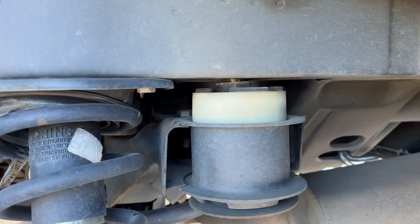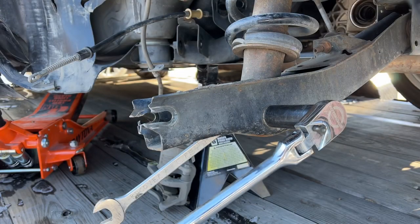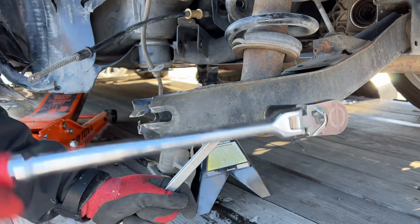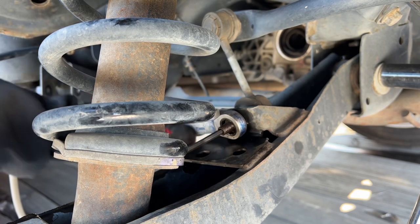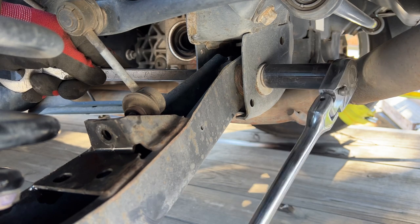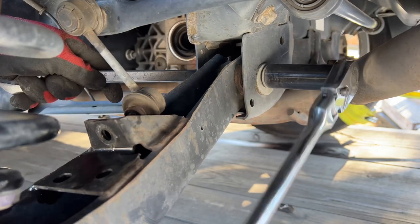Now I'm gonna get to work with these other control arms. I'm gonna go ahead and take this sway bar link — it's just a 15 millimeter. I got that out. Now I'm just gonna go ahead and take that lower control arm bolt — it looks like it's also another bolt where you do the alignment. It's an 11/16 — sorry, 13/16 — so I've got a socket on one side and the wrench on the other so it doesn't spin.